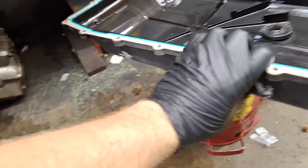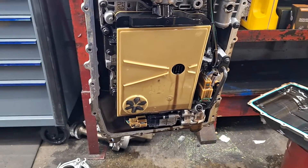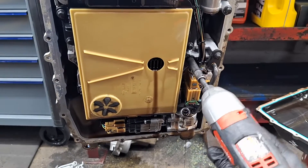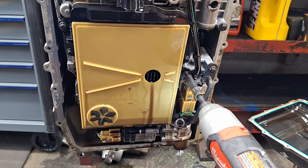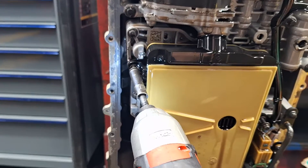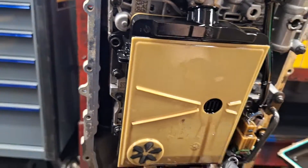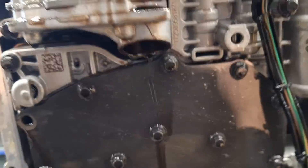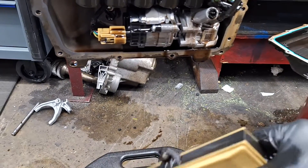By the way, I don't think I explained — a CDF drum, which is the one I'm tearing down to replace, is a drum in the transmission that is issue prone. It has a bushing on it that rotates and blocks passages for fluid to go through and apply clutches — that's why there's hesitation. This is the filter I'm taking out now; it's held in with two bolts and has a little grommet that pushes into the front pump.